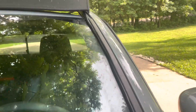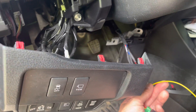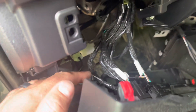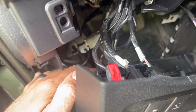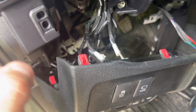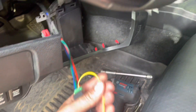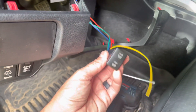I have the wiring harness for the light bar going up the pillar. The power, ground, and the wires going to the switches are poking through the firewall. If you want the switch to be backlit, you'll either have to tie into an existing light circuit, or you can get an adapter that plugs off one of these switches and splices into the light circuit without cutting the wire — like a pigtail connector. It'll come with a connector to plug into a switch, but not this switch.